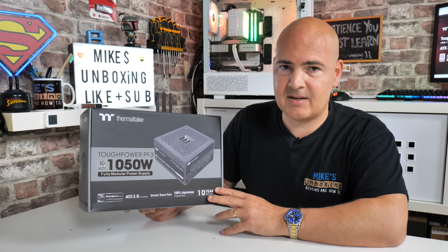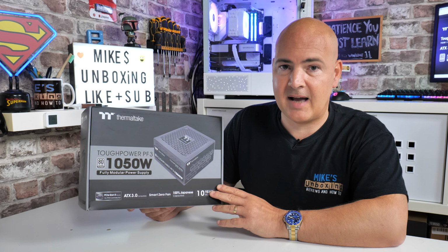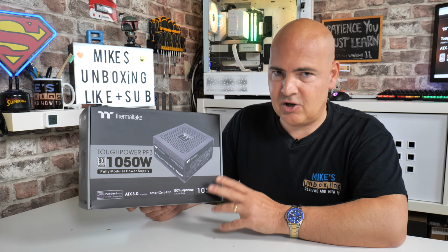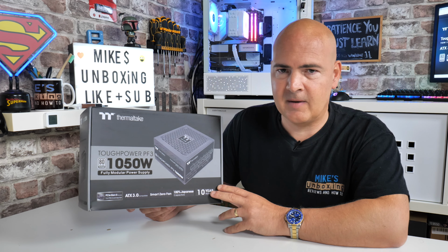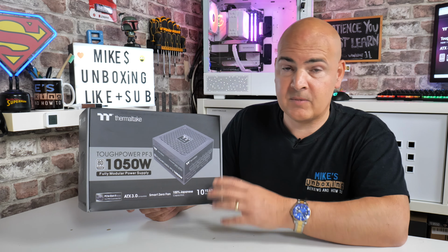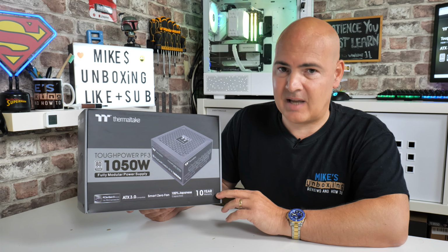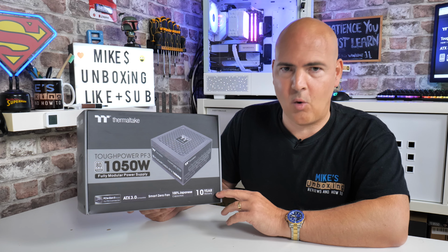Now this power supply has the ability to actually deliver up to 3 times the rated amount as an excursion on the new 12 volt high power connection. So normally they're rated for kind of 600 watts. So potentially you could have a very, very brief spike of up to 1800 watts on that connection and your power supply will stay working, which is obviously what we want.